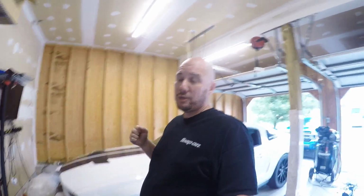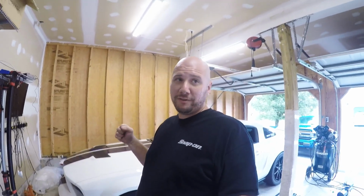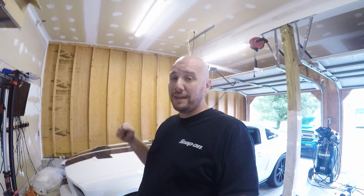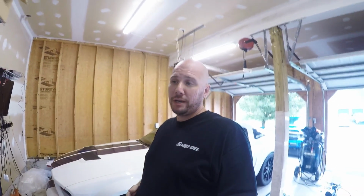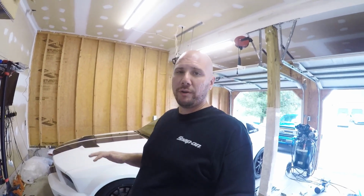So, 2 things I'm going to try. I'm trying the CHE torque limiters first, which we're going to be doing today. That's basically going to lock that transmission to the body of the car, so the transmission should not be able to move under load. If it is still giving me a problem under load, then the next thing we're going to do is a set of motor mounts. I wanted to try the CHE mounts first because it is a little bit cheaper and easier to do than the motor mounts. So we're going to try that first before we dip into that, just because the motor mounts get a little stiff sometimes, and I'm not sure I want to go that route.